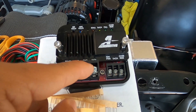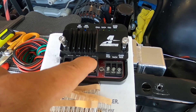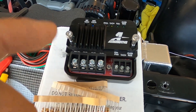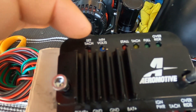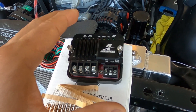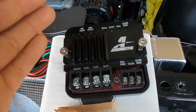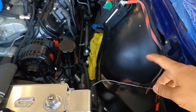The connections are: power coming in from the fuel pump relay, an ignition power wire, the tach signal we just talked about, and the override switch — one lead goes to the controller, the other to ground. Up on the controller you have little dials to set the minimum voltage and to configure the tach signal input. That lets you tell it at exactly what RPM — say 3,000 or 4,000 — you want that pump to be fully juiced up.